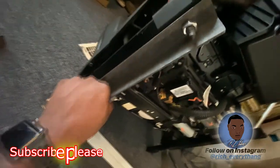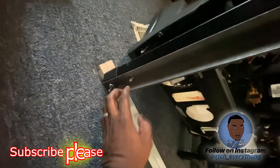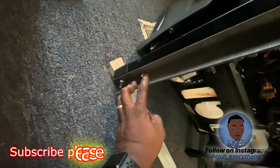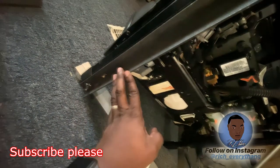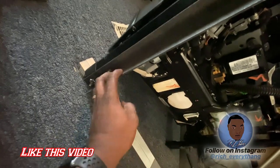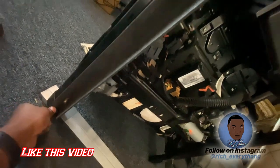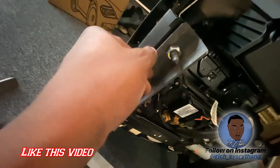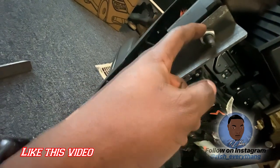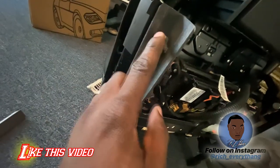All right, show you what I got, YouTube. That's my bracket right there. And you see how sturdy that thing is right there? Ain't even moving. So like I said, I wanted to keep that right there so you can lock your seats down in place. This part right here, I'm going to probably have this set up so where it'll stay inside the car. And then I'm going to probably tack weld these bolts on the outside so they can stay right there. And then that way, once you start to loosen up the seat, the only thing you're really taking out is the bolt right here.